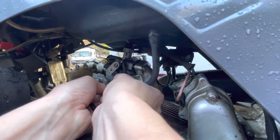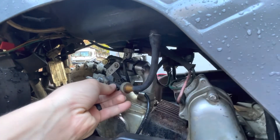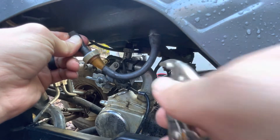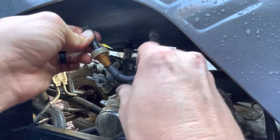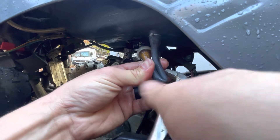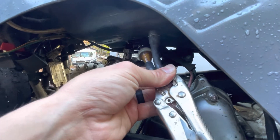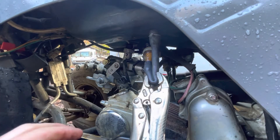Then try to plug it as quick as we can. We can go ahead and fold it right there — a little bit of fuel leaked out, it's not the end of the world. We loosen these up; we don't want to clamp it too tight, but just enough to where it's holding it good. You can tighten it if you want to. Now we got that clamped off, the fuel is off, so we should be good.